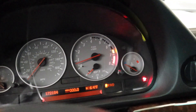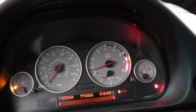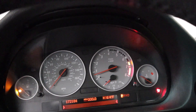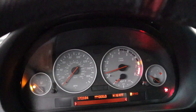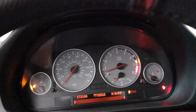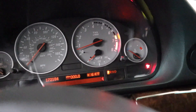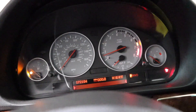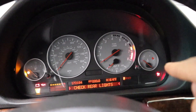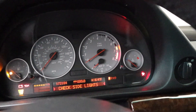I also want to program the lights and the temperature gauge, but upon research I found out I need the X5 4.6is version D software from the DME — I have to write those files so the car can communicate properly and the oil temperature gauge works. But so far it doesn't bother me. As long as I don't have the temper light and the gear indicator works, it's fine.